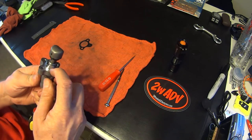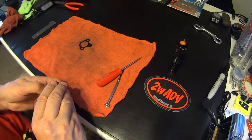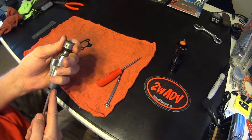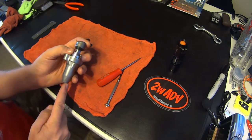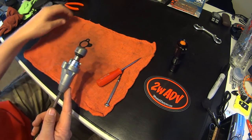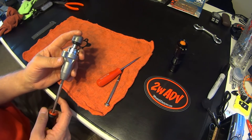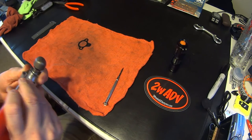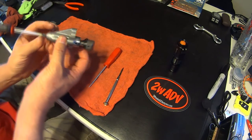Let's go through it again. Assuming it's already come from the motor and you didn't disassemble it: take off the spring clip, move this collar up, pull out your plunger, and then adjust it to as many turns as you feel is necessary. Usually from the factory, if you fully disassemble it, it's four turns. Then the tightening would be pulling this up, unscrewing it, and bringing it back down — that's usually another four turns. Put the spring clip back on. It's ready to go back in the motor.